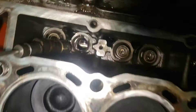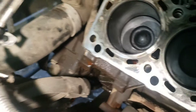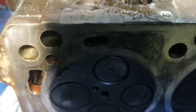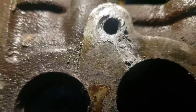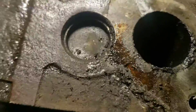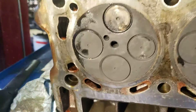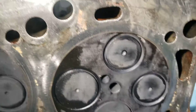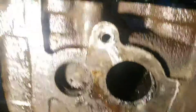Everything looks pretty new - the oil is clean. The deck, it looks like somebody hit it with a rotary tool maybe, but I don't know if that would have made any difference. Here are our two valves in question. With a little bit of fuel down there it looks like it's kind of pouring out. I can't really tell if the valves are bent or anything - it doesn't seem to be the case. There's definitely contact, but there doesn't appear to be any major damage. I've seen nicer cuts than this - I don't know if this was a nicely milled head or not. I'm suspecting something's going to be funny with one of those valves.